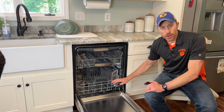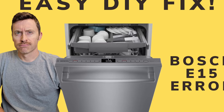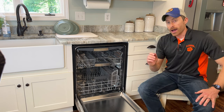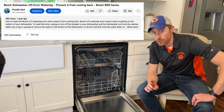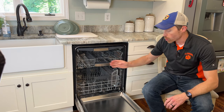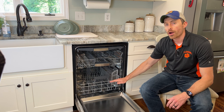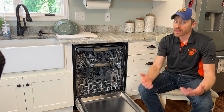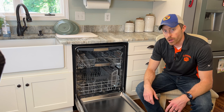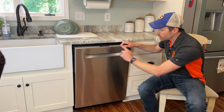So you wake up in the morning thinking you ran it last night, and you get a blinking light telling you the load didn't finish. I put out a whole other video about this problem — you can clean these seals to try to get a tighter seal when you close your door. That video is almost at a hundred thousand views, with hundreds of comments from people saying their Bosch 800 gave them the same problem. If you don't address the door seal issue, you can get water dripping down. There's a sensor underneath the dishwasher, and if it senses any water it will stop and not allow your dishwasher to run. The reason I was getting water down there — and apparently thousands of others were too — is because of that door seal.